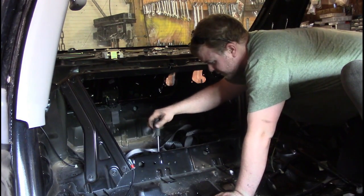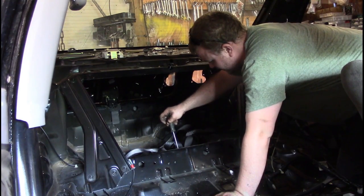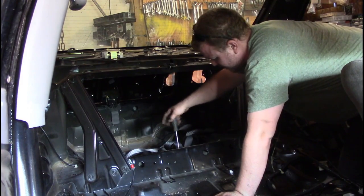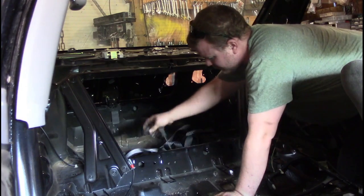With the bottom of the fuel tank cut out, all you do is remove this cover right here, and then it's about six or eight ten-millimeter bolts holding the fuel pump in. Once you remove the fuel pump, that's good for them.